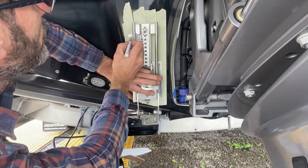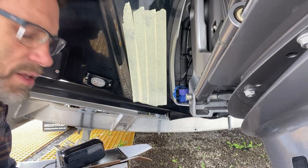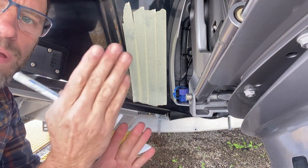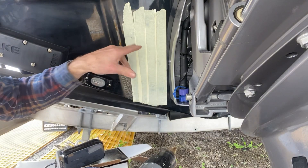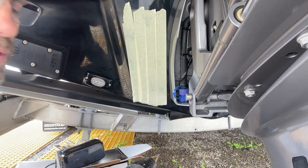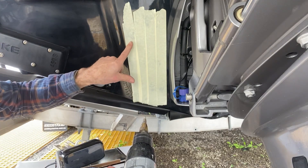My first hole is going to go right up there. I'm only doing one hole at the moment so I can hold it in position, level it up, and have a look. I've just done a tiny pilot hole, and I've got a step drill here to take away the gel coat so it doesn't split — it creates a wider opening at the beginning.